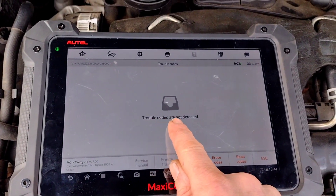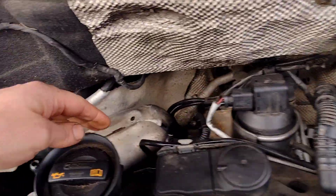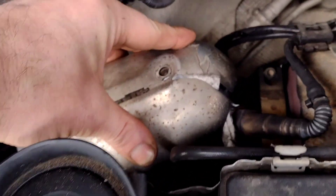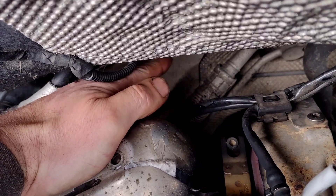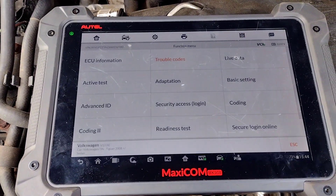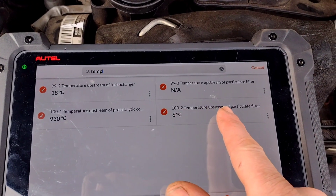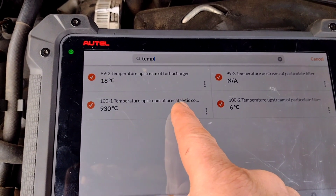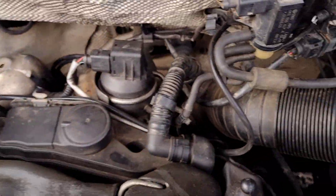What I'll do is some checks - it says it's gone, go straight into it and it's back. We're going to see which one of these exhaust sensors it is. There's one here below the catalyst, one before the DPF, and two at the back - one before the catalyst and one after the DPF. So I'm going into the live data. I've got three temperatures up: upstream of the turbo, upstream of the particulate filter, and upstream of the catalyst. That last one stands out because the engine is cold, so that's a false reading.